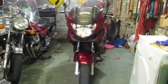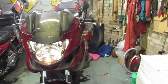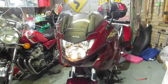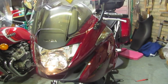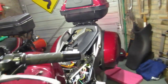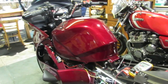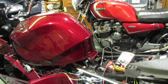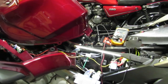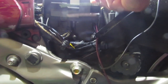Here's the NT set up to investigate the throttle position sensor, to see if that's functioning correctly. I've been getting a lot of this bucking bronco with the power on, power off. I've done lots of investigation and research courtesy of the owners' groups online, and one of the things they suggest is to check the correct action of the throttle position sensor. I've removed the side panel so I can get to the ECU, which I've just unclipped and laid down. You don't need to remove any security bolts.